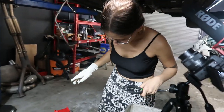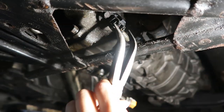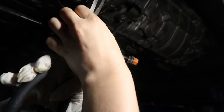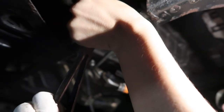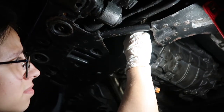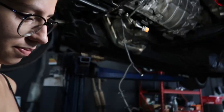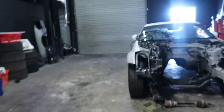It's your crankshaft position sensor. So you just want the tip — and then use your hand and pull it out and wiggle. Ta-da! Is it out? Yeah, cool. All right, get that 10 mil. Pull that sensor out — it should just pop out. Just like that. That's a sensor. Ta-da!